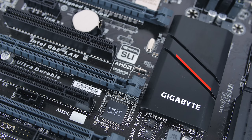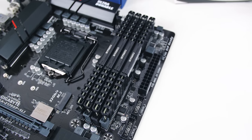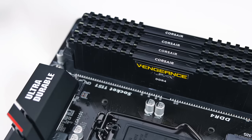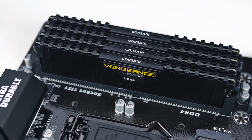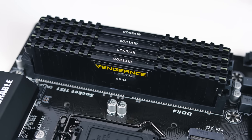There are triple PCIe 3.0 lanes, and the four RAM slots are occupied by 16 gigabytes of DDR4 memory from Corsair. These are low-profile Vengeance modules, and they're awesome for minimal interference.